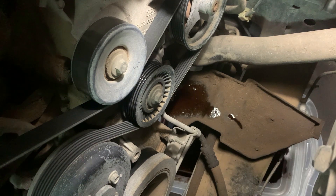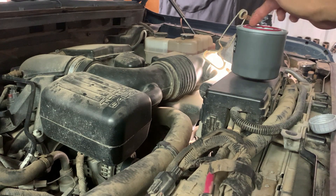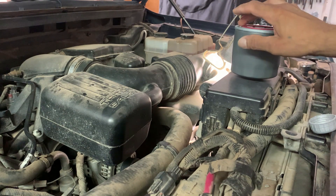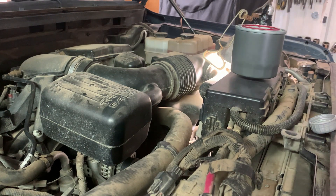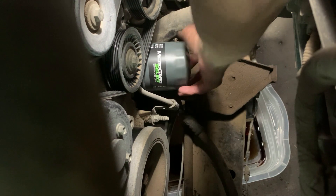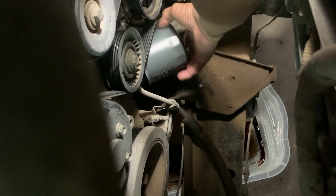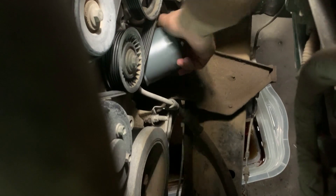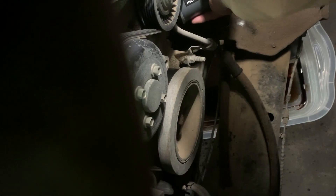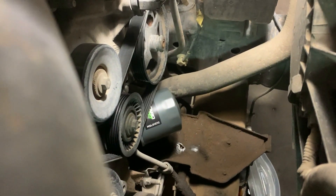Let me take my watch off too. You want to dip your finger in the new oil and just lubricate the gasket — that way you'll get a real good seal. Put a little oil on there; it could probably be used oil but always try to use the new one. Okay guys, I'm going to try to get this filter in there — there it is! Just do it hand tight. You don't have to go crazy with the wrench because then when you take it off next time you're going to have trouble. Just get it tight with your hand — that's good enough.